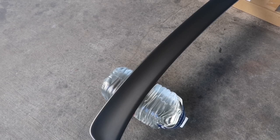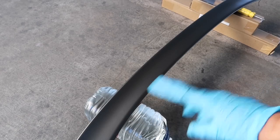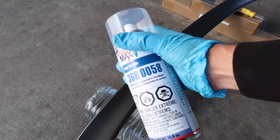All right, so I just went over it and got off a little bit of specks of dirt and white trash that was in it. Anything white against a darker surface, something that'll clash, if it's between the base coat and the clear coat, it's permanent. So make sure to wipe everything down, or just wipe it down in areas where you see trash. So it's time for some Spray Max, and now let's go. By the way, I have the screwdriver right there so I can get the very edge, because I wasn't getting base right there, but I finally got everything.